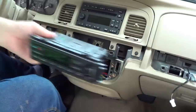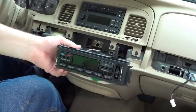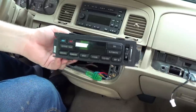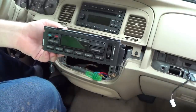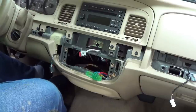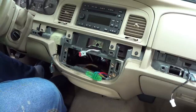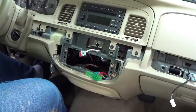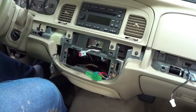This is actually a hybrid system. You have this control module that sits in the dash — it's the brains of the operation. There's a microcontroller inside, a display, and buttons on the front that let you choose mode of operation, fan speed, temperature, and all those things. The blend door, which lets you choose between hot or cold air moving through the climate control plenum, is electrical in nature — it has a little DC permanent magnet motor that drives a gear train which moves the blend door back and forth.